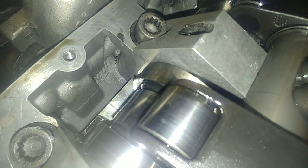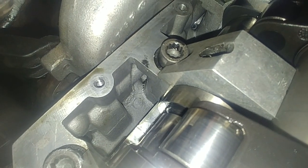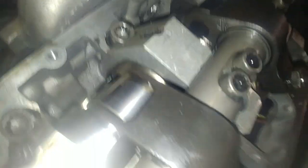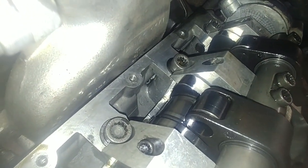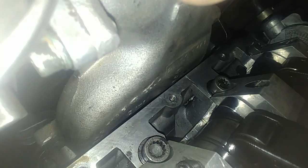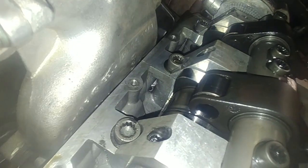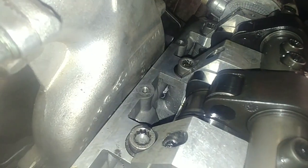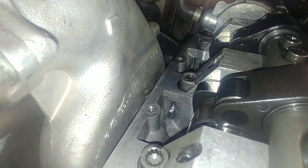Now I'm going to just rotate this. Keep in mind it's a four-stroke engine — the camshaft rotates at half the speed of the crank. Notice it's not always where it appears to be, so you really have to make sure you're on the full compression stroke. It's much easier to use a dial gauge to determine the height on that. This is a very backyard method; I don't recommend using this. If you do it properly, you'll only do it once.